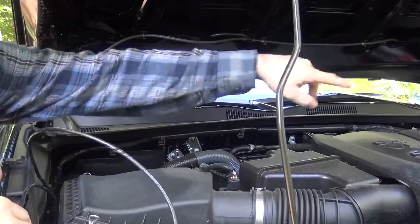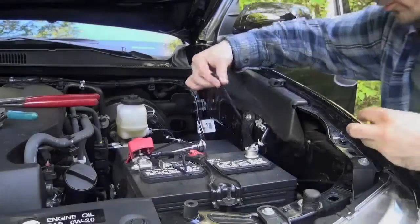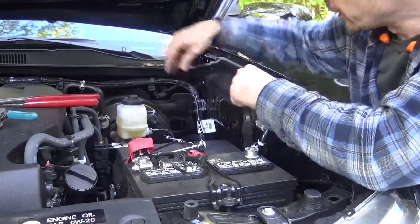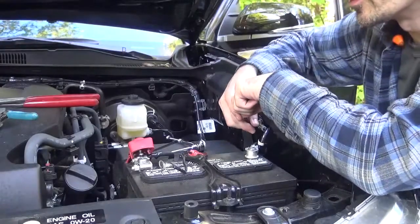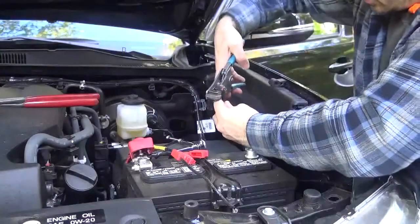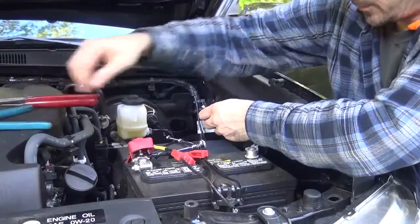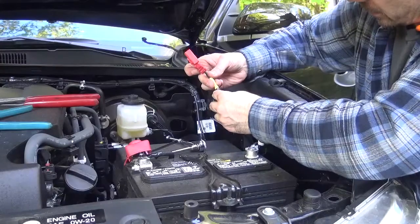We're going to work our way over to the battery and just connect it up, and that will be supplying the power for the radio. We ran our power wire from inside along the wire loom — the existing wire harness, factory harness. It pretty much blends in; it's covered with black electrical tape just to make it blend in. We're going to put on the fuse — make sure you remove the fuse — and just strip this and prepare this, and then we'll waterproof it later.